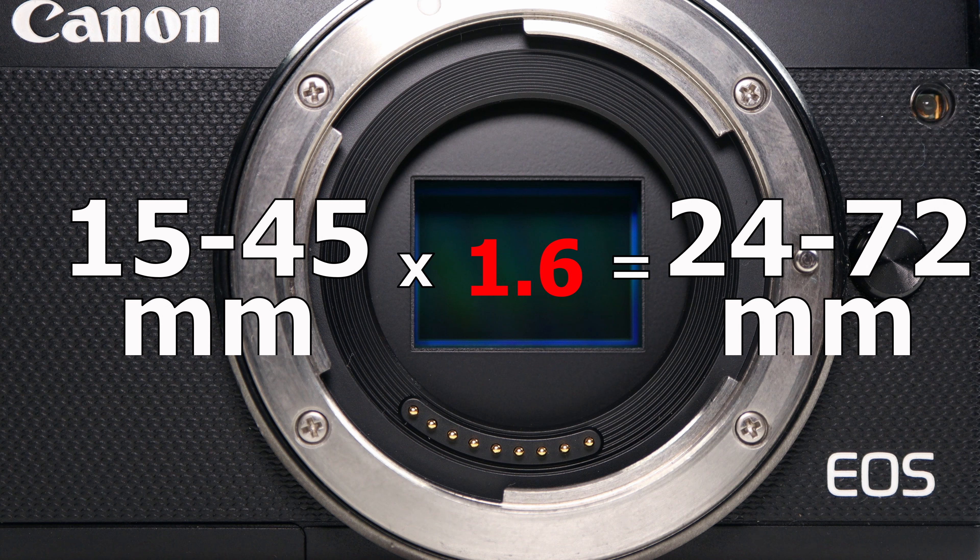First thing: what's on the lens? On the body we see the full name of the lens. If you want to put a filter on it, we also see the filter thread size of 49mm. Next we have the zoom ring with a nice plastic texture for more grip, and the focusing ring. The lens is retracted — to unlock it, we must pull the switch up and rotate. On the bottom side of the lens, printed are the words 'image stabilizer,' showing that the lens has optical image stabilization. We also see the minimum focusing distance, and lastly, the lens mount, which is made out of plastic.